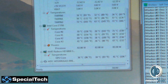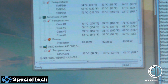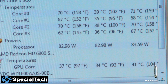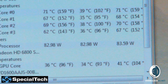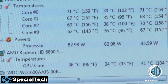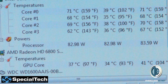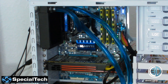You can see that Prime is running. The system is at 200x20 for a 4GHz overclock, with 2000MHz RAM at 1.25V — and there are the temperatures. The hottest core is 70°C and the coolest core is 62°C. I have tried messing about with the block to balance the temperatures out, but the 950 that I've got — the temperatures across the cores do fluctuate no matter what I've got in there. So you can see the temperatures at 4GHz on full load, and it's been running now for 45 minutes.